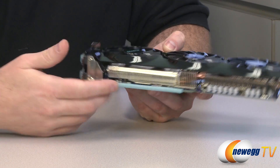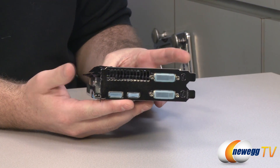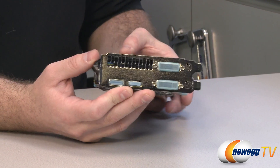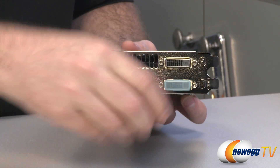This card will fit in a Gen 2 board and you're not really going to suffer much of a performance hit. It's mainly a bandwidth increase with PCI Express Gen 3, plus some efficiency gains. Most benchmarks show you can't really saturate PCI Express even on Gen 2 with the current range of video cards.